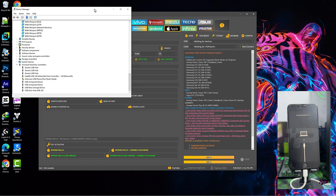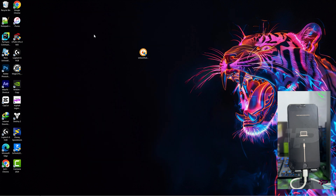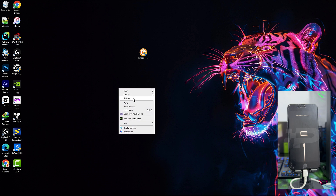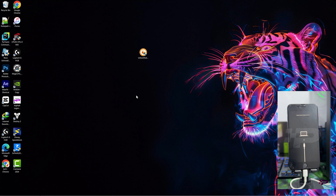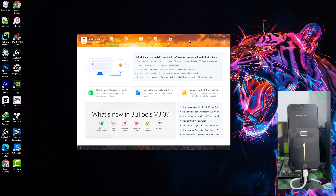As you can see in the video, the iPhone 7 is currently in recovery mode. Now let's head over to our device manager to check if the driver is showing correctly. If it doesn't show correctly, we need to fix the driver. I'm showing you guys this step-by-step process because you might encounter an error if the driver is not fixed. So let's go ahead and open 3U Tools, which is another multifunctioning software for iPhones.